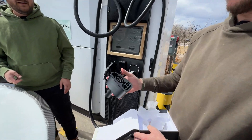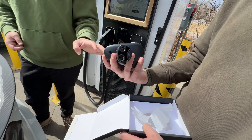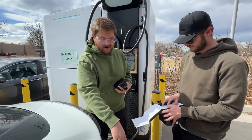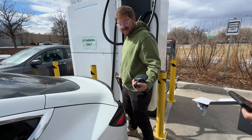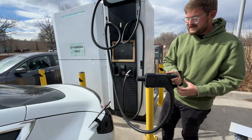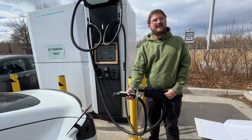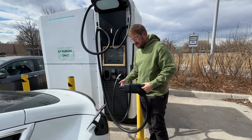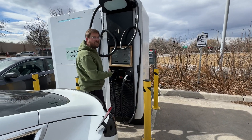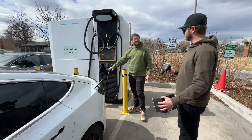This is the CCS adapter. There's no real logic in here — it's just taking these pins and rearranging them to those pins. There are a couple of thermistors and some other stuff, but there's no communication changer. According to the car, if I plug in like this, the car has no idea if I'm doing this with the adapter or straight plugging in NACS — they're effectively the same to the car. The adapter doesn't leave a signature or breadcrumb anywhere in the communications. By upgrading older Teslas to support CCS, you also make them support third-party NACS.